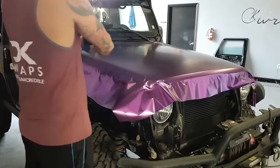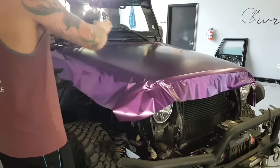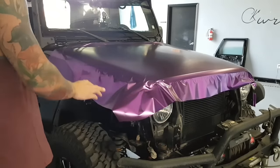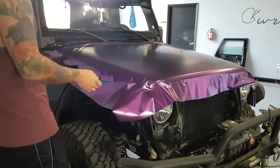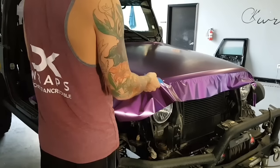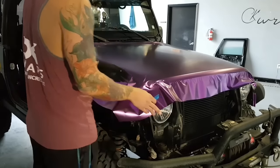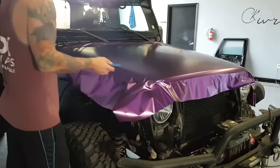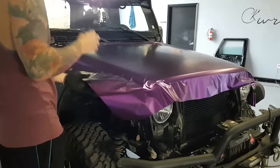While with Vivid, you don't get that ever. Like on the matte black finishes, gloss black, satin chrome, gloss chrome, I've never ever seen it. And it's amazing because how smooth the surface is is not even comparable. I mean, if you can install Vivid, 3M or Avery or anything else without repositioning it, then you won't get those lines. But for the most part, you're going to have to reposition at some point, especially if you're doing this alone. So just a little FYI there.